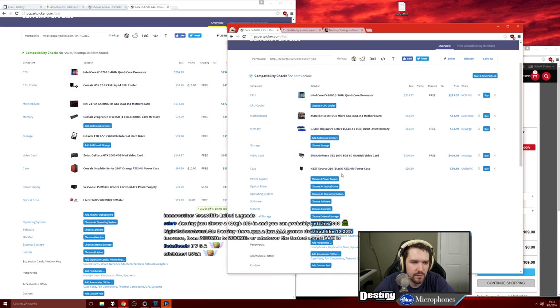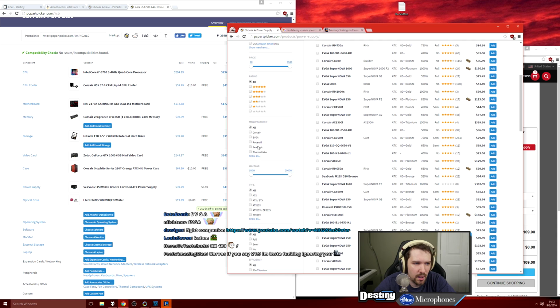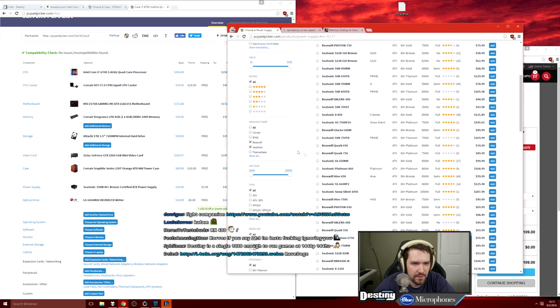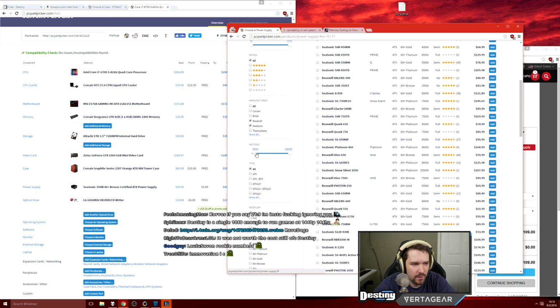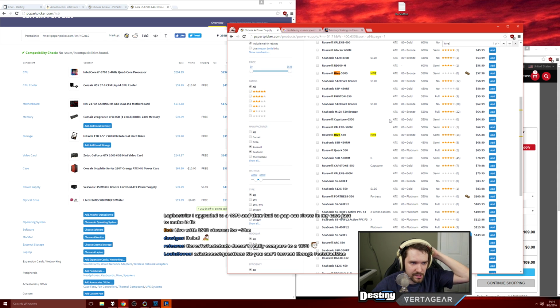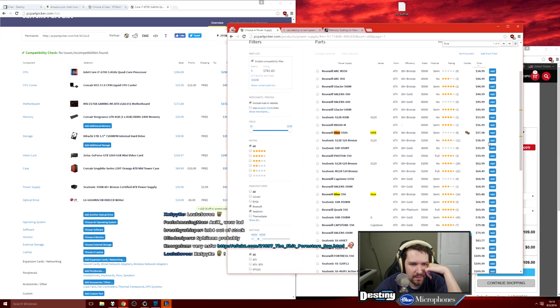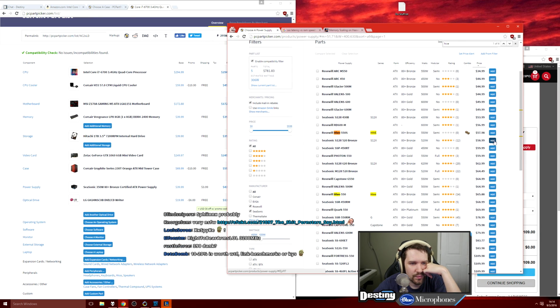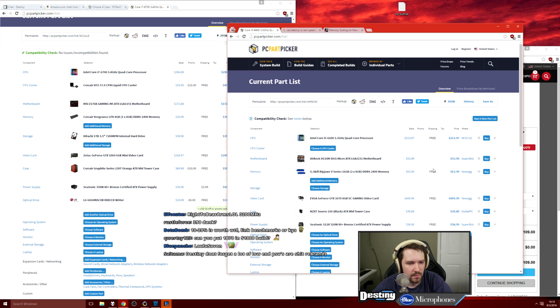For a PSU, 450 is plenty fine. I know that Seasonic makes good stuff. I know that Rosewill has some good lines. For wattage, we'll aim for like a 450, okay? The only line that I know for sure is good from Rosewill is the Hive line, but I know that everything Seasonic makes is good. So this is a 520. The 520 is honestly overkill, but we'll grab this.